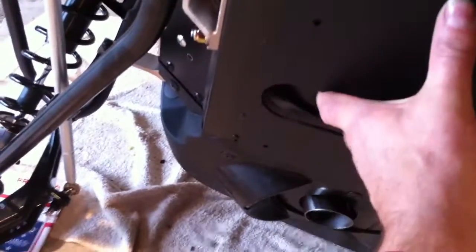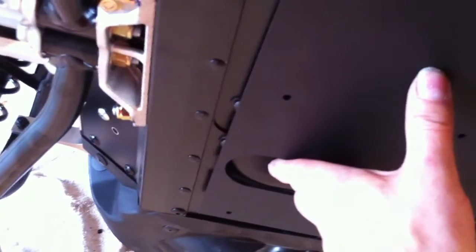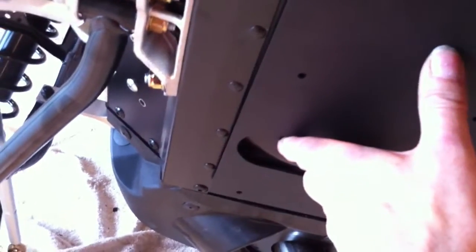I don't know what that is, actually. That lines up with that. But what it doesn't have is this hole cutout — this is for your oil change on the four-stroke. Chris makes these for the E-TEC, so I'm going to do some cutting to this plate. I'm not sure if Chris makes these yet for the four-stroke, but I told him I had no problem doing a little modification. I'm going to cut that out big enough so I can get at it later to change the oil, and then rivet this new plate on.